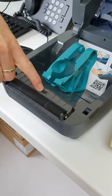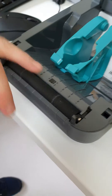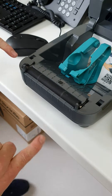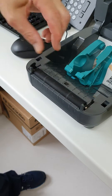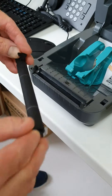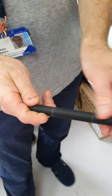Your little label sensor should be uncovered and nice and clean. The roller should have no labels on it. To take the roller out and clean it, you press that one forward and up, and this one forward and up, and then the whole assembly comes out. You can see there should be no labels wrapped around it and no glue and nothing.